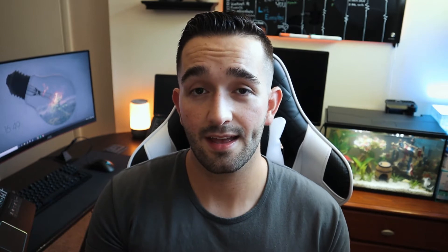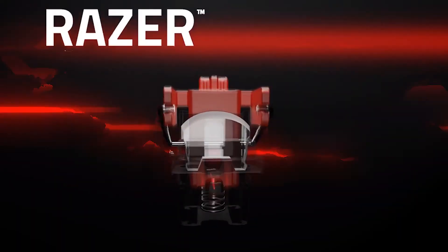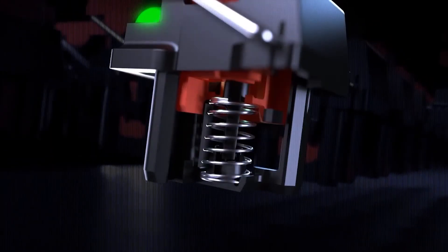This is really cool for a couple of reasons. From a durability standpoint, in the traditional mechanical keyboard there's a little arm that's always pressing the metal contact to complete the circuit with every single key press. Over time that just wears down and eventually leads to failure. But with the optical switch, there is no metal-to-metal contact required to complete the circuit — it's just a beam of light. That means extremely good durability, which is why this keyboard is rated for over a hundred million clicks. You would never click that many times, but it's extremely reliable.